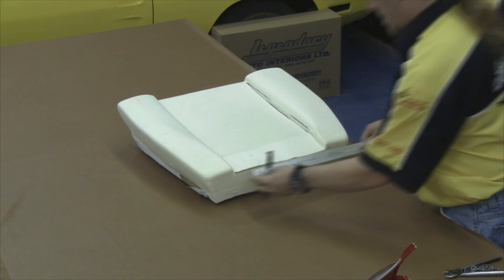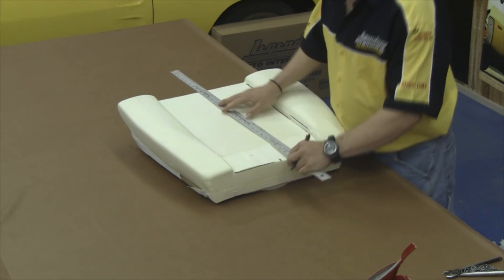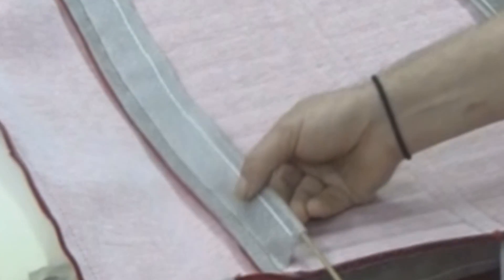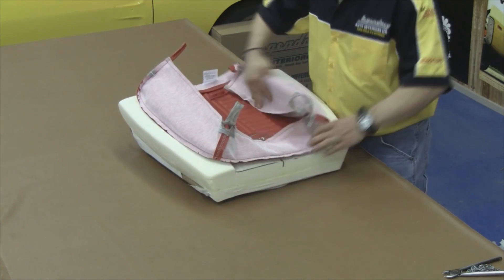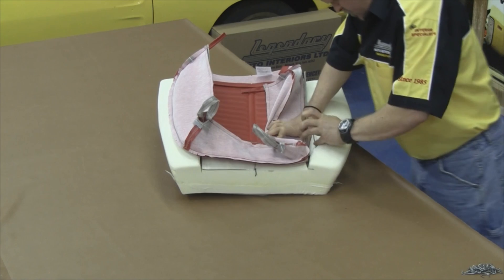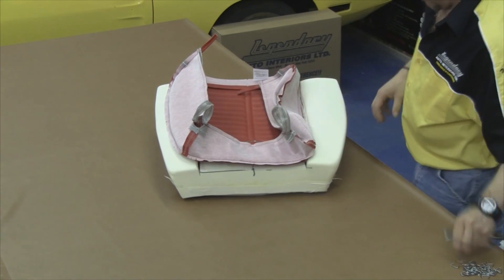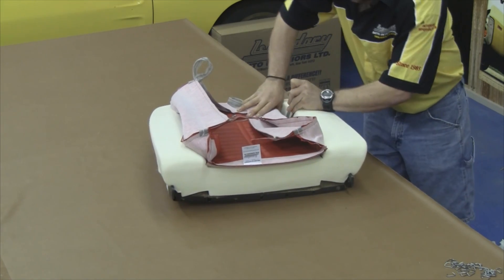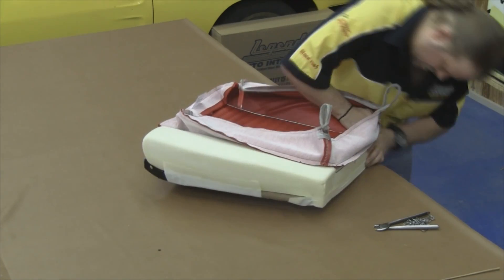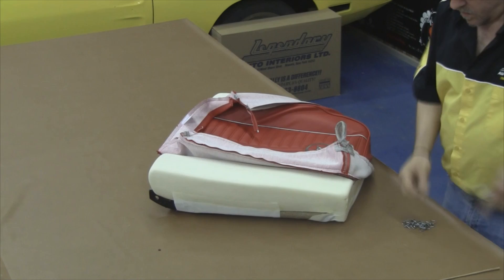Our first step on our front seat top seat cover installation will be to find the center point of our molded foam kit. Measure the top and bottom edge and draw a line between both — this will be our center point. Next, we want to insert the paper-coated listing wires into the pockets sewn into the seat cover. We first want to symmetrically place our seat cover on top of our molded foam, making sure that the welt or piping rides along the top edge, and then tuck down through the molded foam the listing pocket that we just slid our paper-coated listing wire through. We want to hog-ring around the paper-coated listing wire, through the listing pocket, and hog-ring it to the listing wire attached to our seat frame. Repeat the process on the opposite side, then wrap the top edge over the corner and pull the seat cover to anchor it with one hog ring.